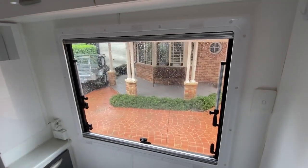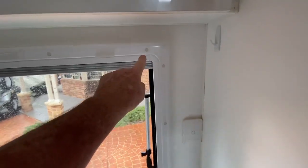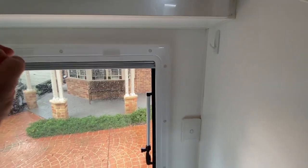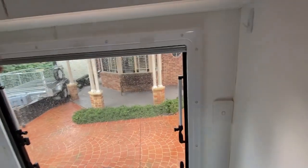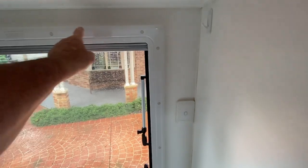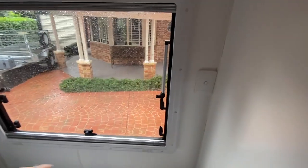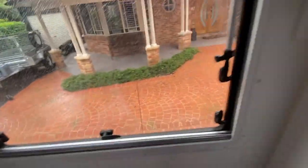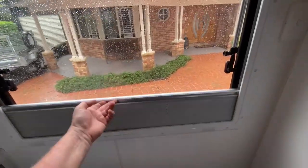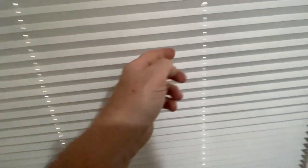Now we've put the surround back on again. We've lined up each one of the screw holes — these ones here — with those hexagonal retainers that hold the outer window in. They line up directly with those. Don't over-tighten these screws too much — they'll sit hard up against the post behind it but you don't want to over-tighten and crack the plastic. And once you've got all that nicely in place, just put the caps back in and test your window. All our cables are lined up properly and tension is nicely set.